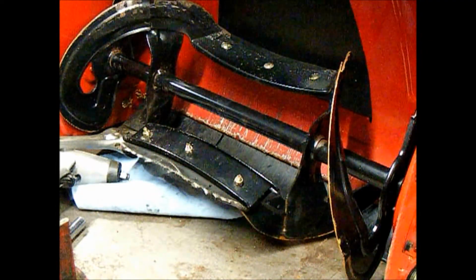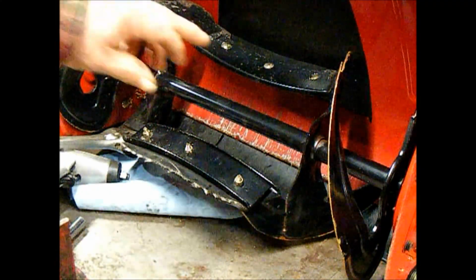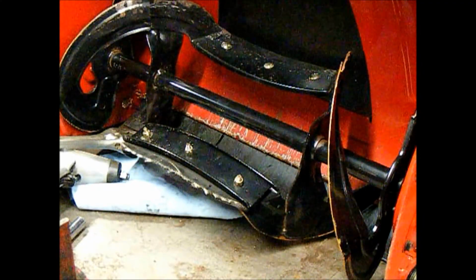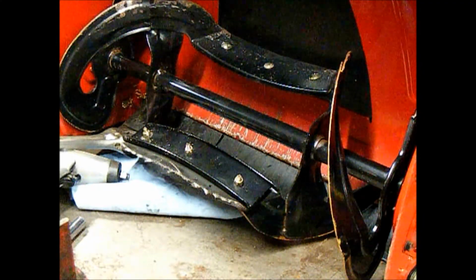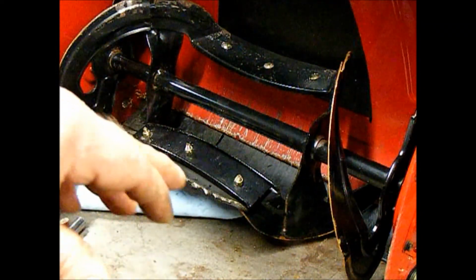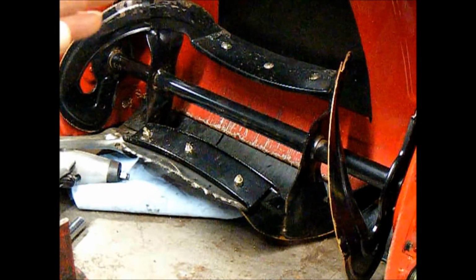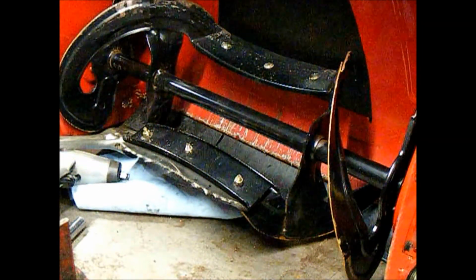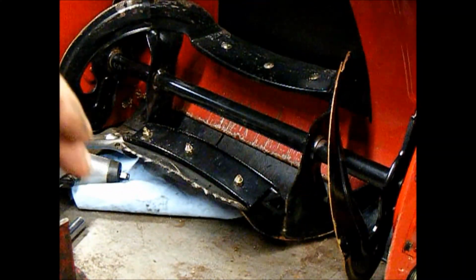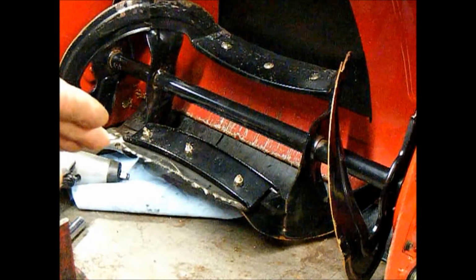I've already done an oil change and spark plug on it. Also, the edges of the augers are kind of chewed up and have very sharp burrs on them from contacting the asphalt. This type of snowblower, the skid shoes on the edge of the scoop were adjusted all the way up, so it was as low as possible. And then what happens is, if you lift up on the handles a little bit, it allows the augers to grind against the ground, against the asphalt, and that's what's happened to this one.